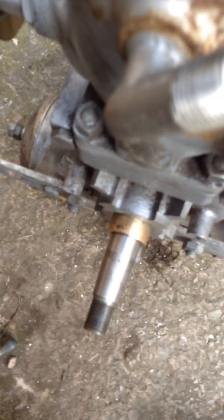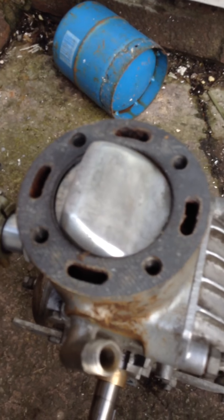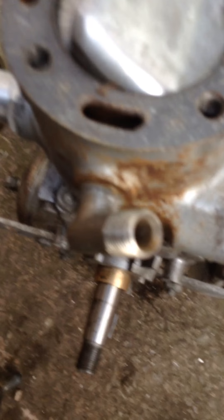I'm going to have to get this in the back vise and then get the drill with the wire brush attachment and go all over it and strip it of all this nasty stuff. I'm going to do the same with the ignition - the points and ignition are all rusty. I'll have to do inside there as well, which isn't a problem because the engine turns over without any problem. It's starting to shine up nicely. See, there's the piston, and I cleaned up the top of the head.